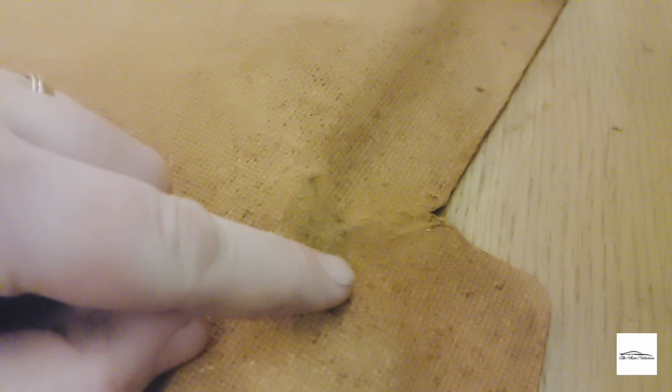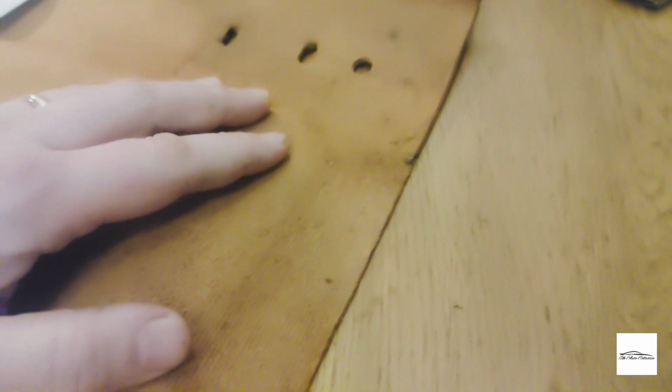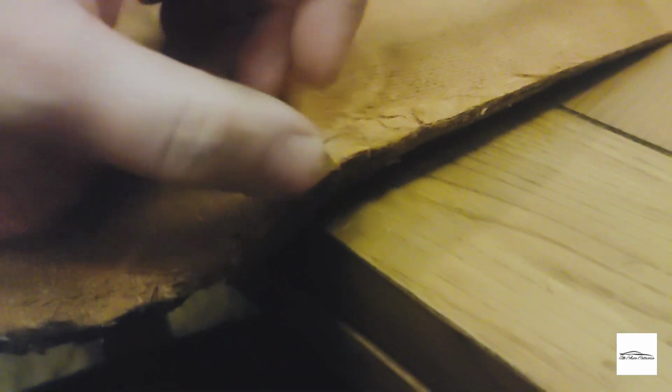Now this crack I have filled in and sprinkled some of the sawdust on to hide it, and the same here, and I'm really happy with the outcome so far. So I'll let that set properly and I'll flat this back. But for now, with regards to this being very, very flimsy, what I'm going to do is open it up ever so slightly like that, put epoxy in the center, and then clamp it, and hopefully it will go rigid like these corners.